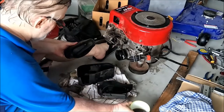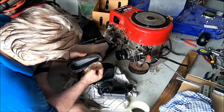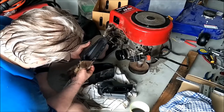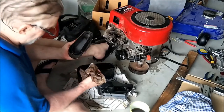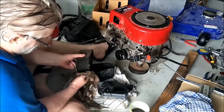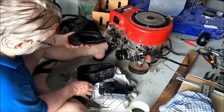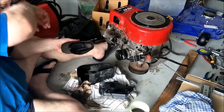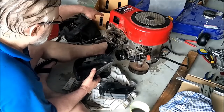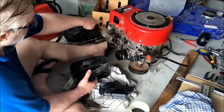Do you need something further on the ground? No, I've got a bag here. I'll degrease it later. Okay. There was a ton of oil in the carburetor. When I bought this engine, the guy couldn't get the thing started, and after a lot of mucking around, we got it to run very, very roughly. That's the one that we picked up in the middle of Brisbane? Yeah. And there was a ton of oil. I'm just trying to think how, I had it tipped over on some side, so this oil can obviously get into the top end through, it's got an overhead valve, so obviously there's push rods and stuff from the sump through to the head area.